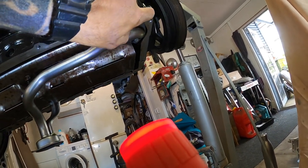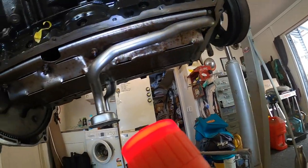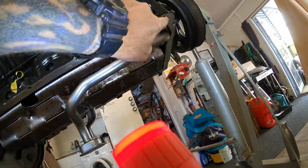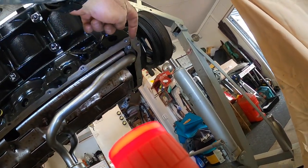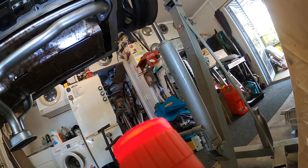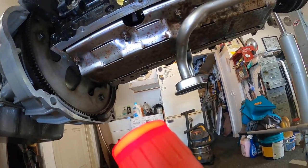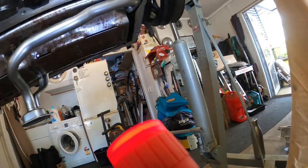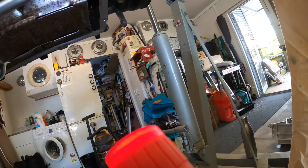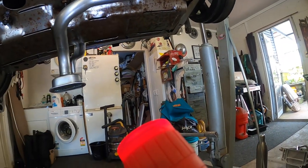This is why, I think, some people say you don't have to because it's an O-ring style gasket, but it's these two seams on each side, so four seams altogether, that have a little bit of spacing in there. So that's the only point that really requires any RTV, I reckon. I've heard of people putting it all the way around, but that's pretty old school small block Chevy stuff. I reckon I'll just put another little fresh dab on each corner and then just bolt this mamma jammer up.